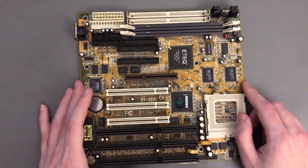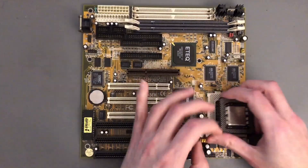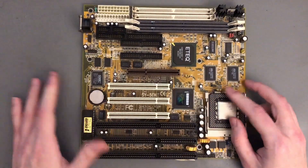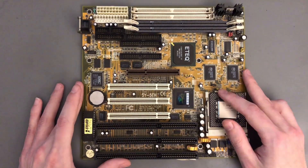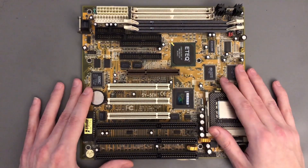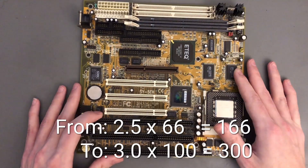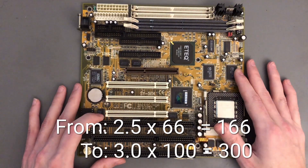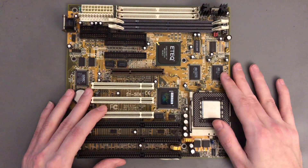After all these years I still think that this motherboard was a very good purchase. Back then I used it with a Pentium MMX chip — that was the 166 model. And probably most of you know where this is going. This combination has an unbelievable overclocking potential, and in fact this system was the first one that I personally overclocked. I managed to achieve a 300 MHz clock by using a multiplier of 3 and a bus speed of 100 MHz. This is an overclock of 80%, and you can imagine what a big impression this made on my teenager self.